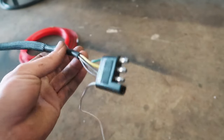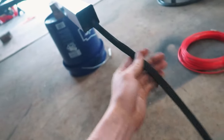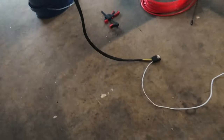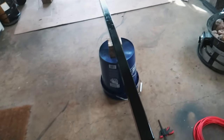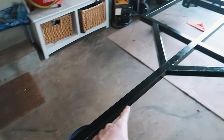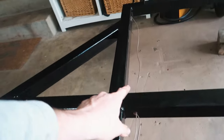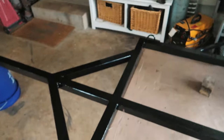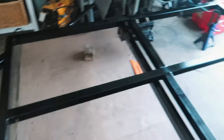Getting started on the wiring. I took some heat shrink and braided cable protectant and made my initial lead all protected — that's what'll be plugging into the truck. It may not be exactly that long once I pull some slack through. What I did was feed each wire I needed down this main tube since it's one solid piece, then drilled some exit holes to branch out to where I need the lights. For my marker lights, all you need is one power wire to each and then you ground it to the chassis.